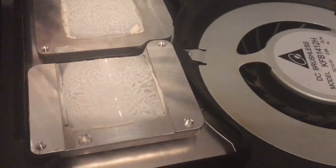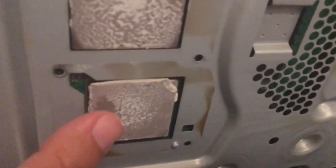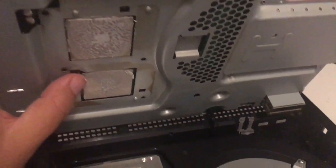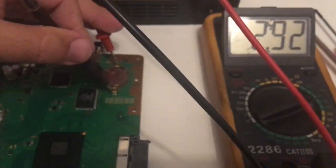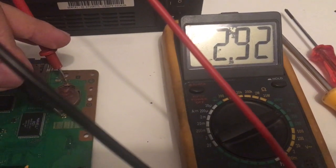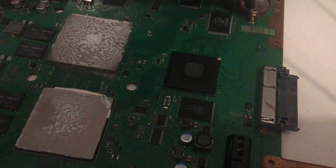Let's see if that will help. If not, I will open everything up and remove these two plates, but it's risky - there are a million YouTube videos showing it, and I can show it also. While we're in here, check out the CMOS battery - it's almost 3 volts, which is how it should be, so it has been replaced. Next up, clean these two chips.